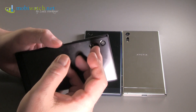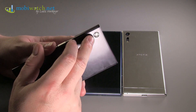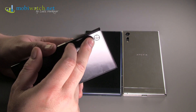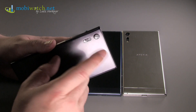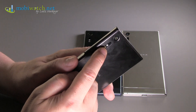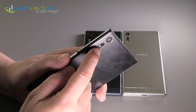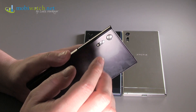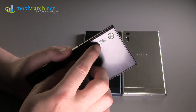The main focus has been on the camera — of course, it's Sony. It might seem the same as on the Xperia X with 23 megapixels, but there is new hardware and software. Starting with the autofocus: there is a new little sensor for colors, detecting not only in the visual spectrum but also in infrared, so you can have more precise colors because it detects white balance even better.